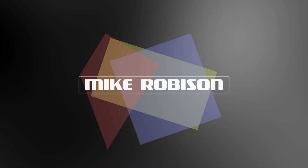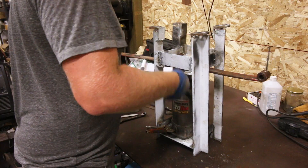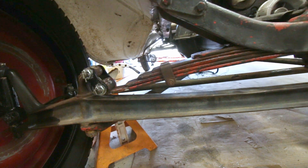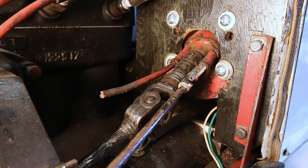Let's go ahead and start off where we left off. Got done just doing the front end on this guy, so I reversed the eye on the front spring on both sides, also went ahead and put on the late '26-'27 spindles. Now we have to work on the firewall and the steering — all that kind of works in conjunction with itself.